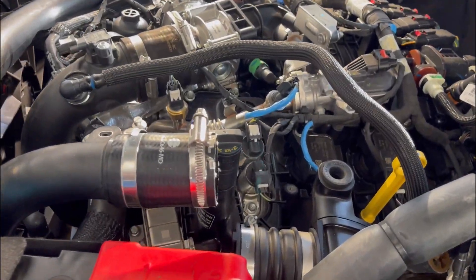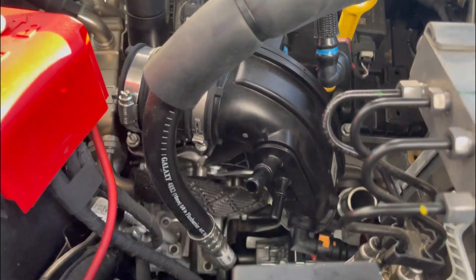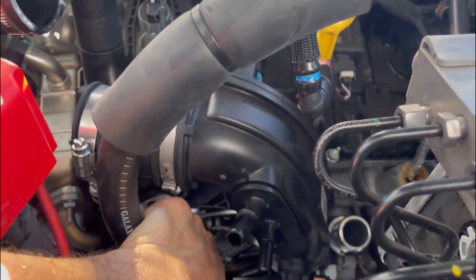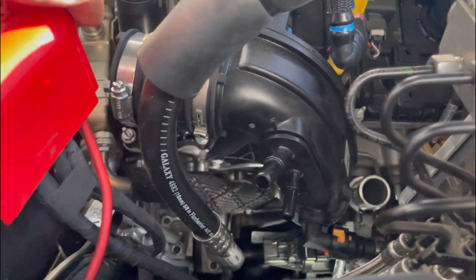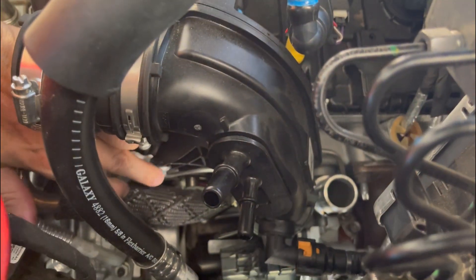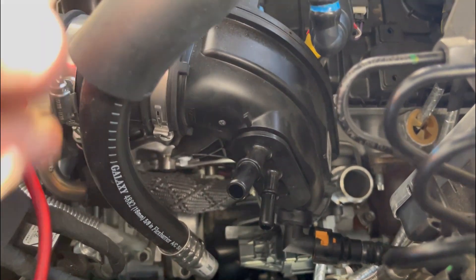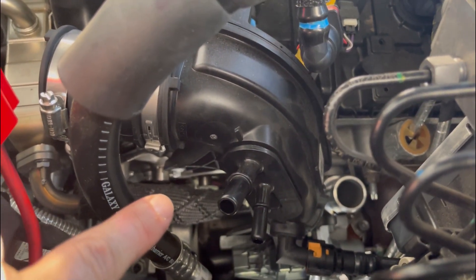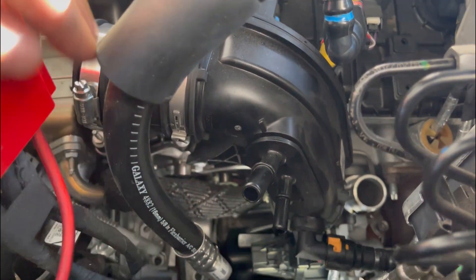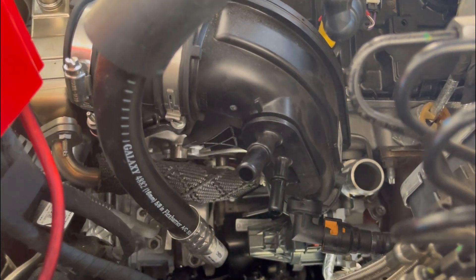Now they want us to remove the bolt holding the driver's side intake tube that's attached to the engine. Coming down in here we want to get that bolt — right here — that's what's holding this housing on. It is a 5/16ths bolt. You may be able to reach it through the wheel well; I'm just going to use a socket wrench and try to loosen that up.